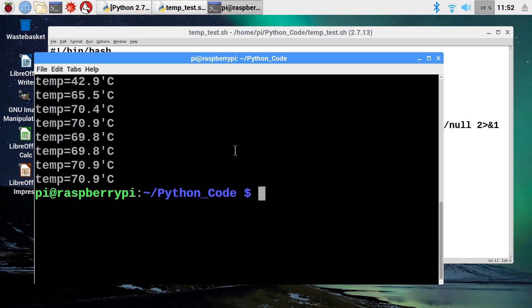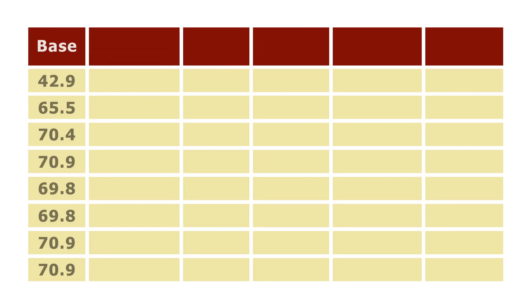The test has completed. The Pi settled at around 70 degrees C, which is significant because the Raspberry Pi 3 Model B Plus has a clock speed of 1.4 gigahertz but drops back to 1.2 gigahertz around 70 degrees. It'll then throttle at somewhere over 80 degrees. So we'll take this data and put it onto a table which will build up across the video as we try out a range of cooling solutions.